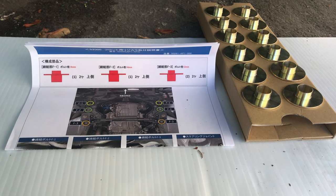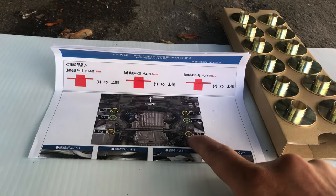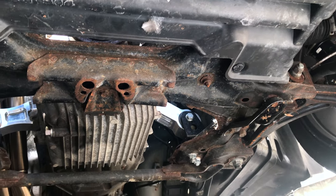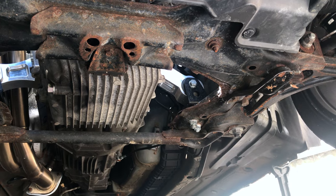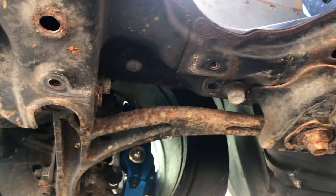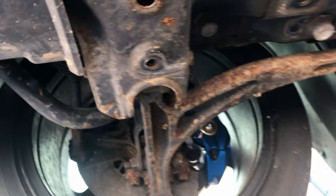The instructions are laid out in the order they go in — the two big collars are for the two 19mm bolts on the subframe, and the smaller one is for the 17mm bolt. Looking underneath, I should probably source a replacement subframe and get it powder coated, but that's for another day. We're just gonna loosen the bolts a little bit, let it hang, and work one at a time. Starting by removing the three 14mm bolts — one here, one here, and one there — to remove the bracket and access the 19mm bolt.